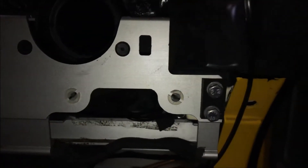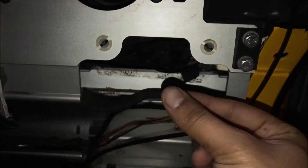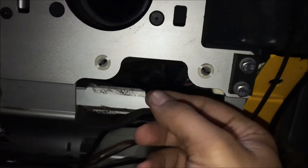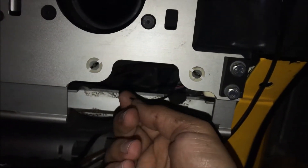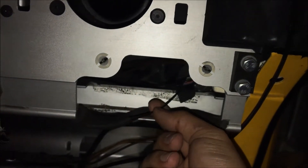You can take your wire strippers and cut that, or you can also get a butt connector and crimp it — connect it there. Make sure it's the type that has heat shrink on it so you don't get any moisture into that wire and possibly cause corrosion.